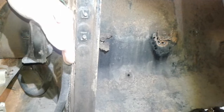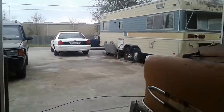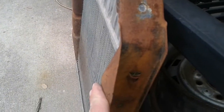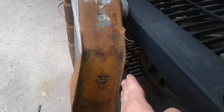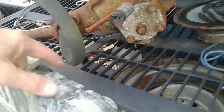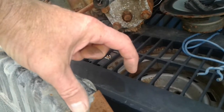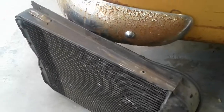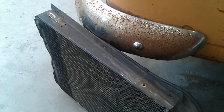Now that may not work for you because of the way yours is built — yours is oriented so the fitting is at the engine side of the core support. By trying to move it to the other side you'll find it pushes too far. This is the old radiator from the 1947 Chevrolet pickup I did. When I got the new radiator I found I was way too close — the 235 versus the 216 made a difference.